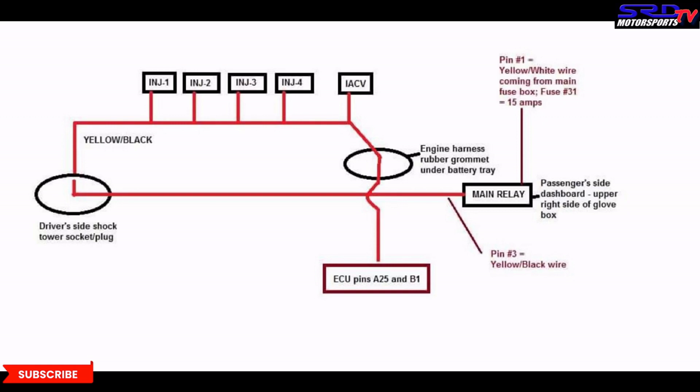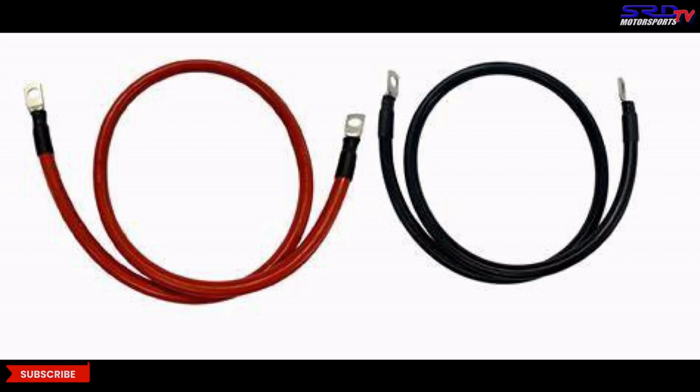With inadequate wiring, your injector duty cycle percentage goes up and you'll start to experience running out of injector headroom. This is why we've seen cars that seem to need bigger injectors even though the engine is mild — it's not that the engine is lacking fuel, it's the wiring. Some cars with single overhead cams keep going cheap on components; a 240cc injector is good for 200 to 210 horsepower, yet they upgrade to Type R injectors without addressing wiring.